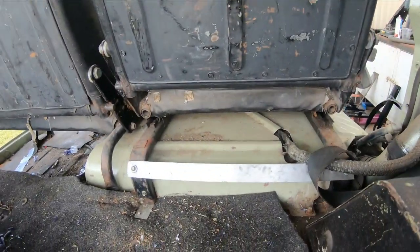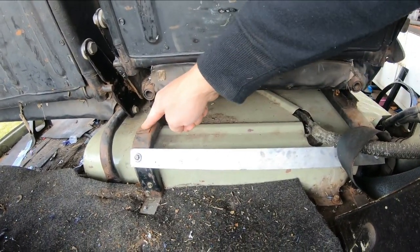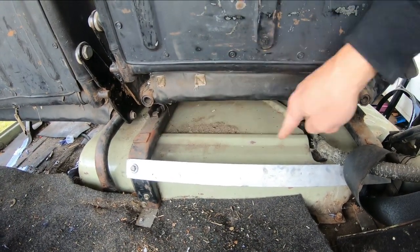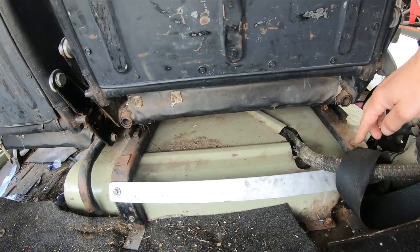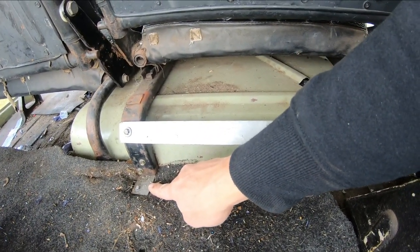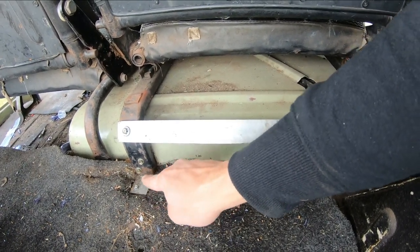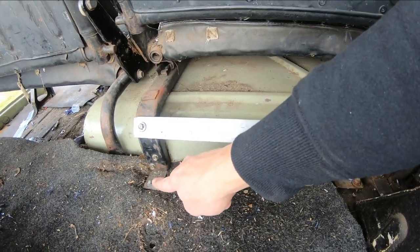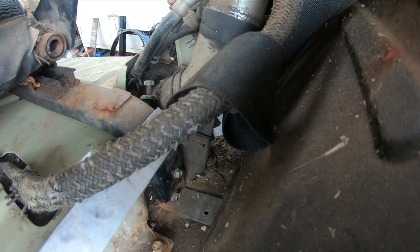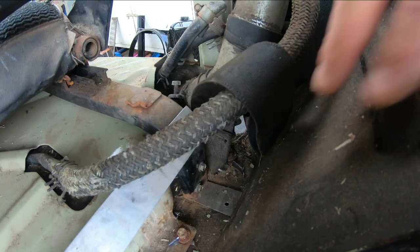All right, so at the back of my seat, I've got a bit of aluminium brace here because this brace here is broken. So we'll repair that, make sure that's the correct brace that goes along there. Now here, I'm not sure what's supposed to be here, but we'll find out because that's pretty crucial. They've got a bit of gow folded up with some tech screws in it and a broken bolt. Same over here, bit of gow, a couple tech screws, and nothing holding it in.